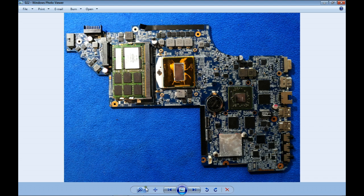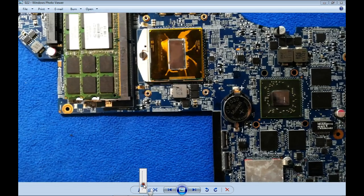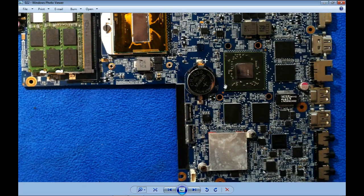And the reason why I think so is because there is a glue paste that the factory puts on the corner and it is missing. We can see it here in the chipset. We can see the blue paste around the corners. So any kind of supposed technician tried to remove the paste and reflow the chip. How do I know they reflowed it? Because the green color is now brown. It doesn't look like this, like the RAM. It looks more brown, which means it was exposed to heat already.